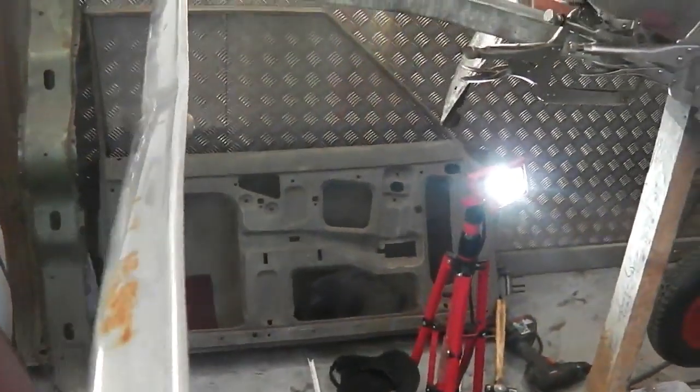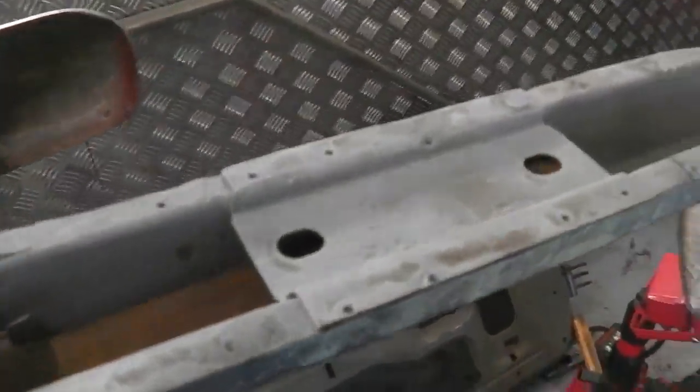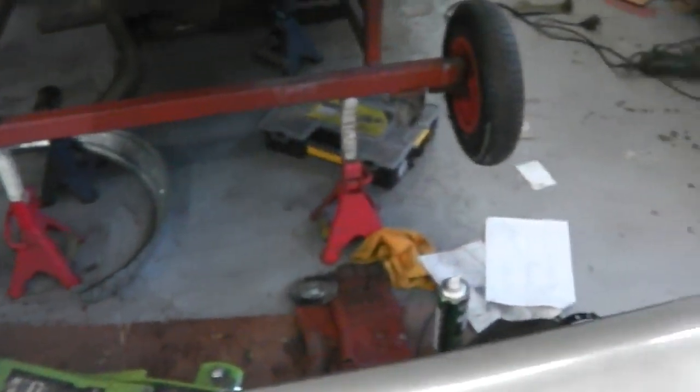This bumper's not been adjusted since it just slid straight off the car, so it's going to be spaced for a Mark III Cortina, and you can see the bolt hole just coming into line there with an acceptable amount of tolerance. There is a little bit of adjustment on the end of the bumper, so we're in the right zone.